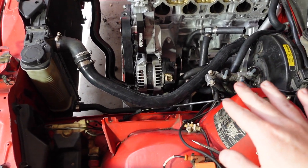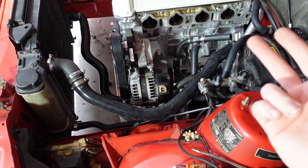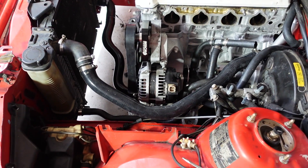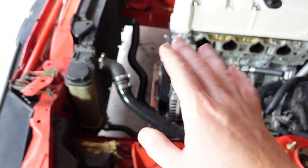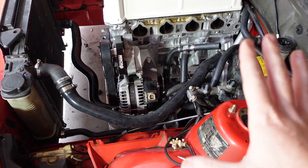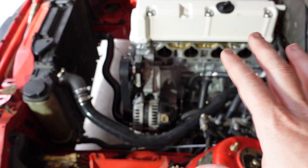The biggest thing I want to make sure of is that none of the hoses touch anything hot, anything sharp, or anything that's moving — those are the big three to stay away from. I'm going to make sure as I go that nothing is touching anything hot or moving, so I will need to make a bracket and keep everything out of the way in its actual location.